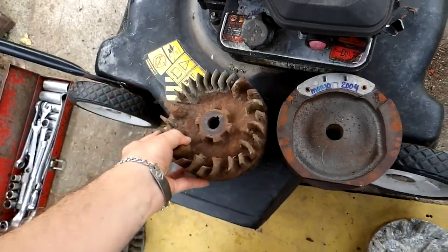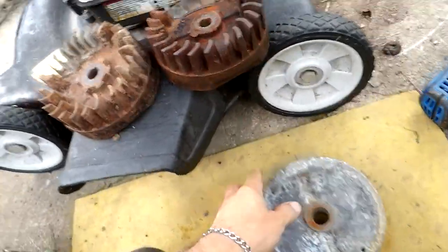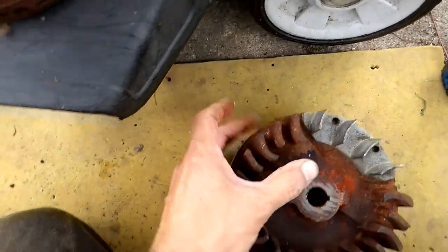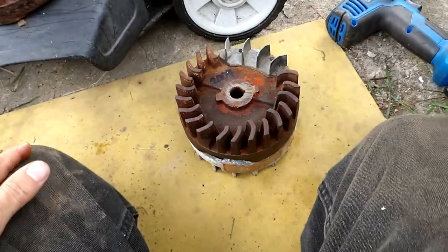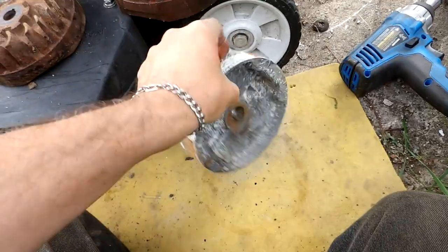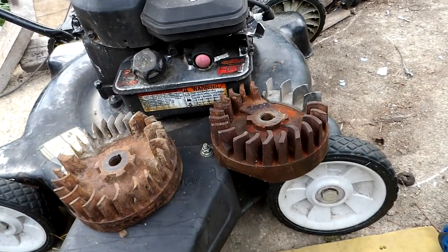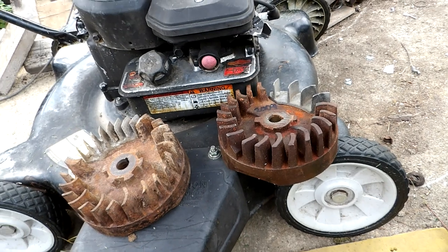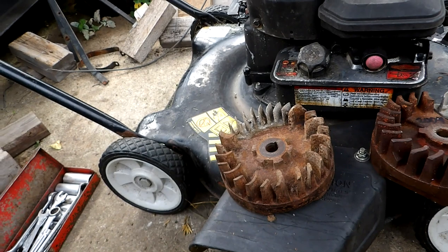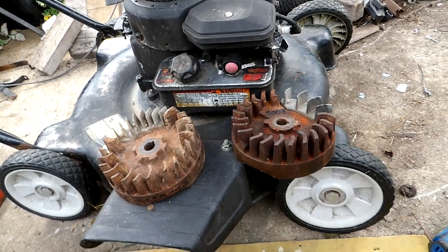So that's your two heavy flywheel options. The main thing is you'll be able to notice immediately if it's going to fit — the outer diameter's got to be the same. It is — it's identical. I've run these flywheels on my Franken-Briggs builds, like the 12-cylinder I made. I collect the heavy flywheels just for such purposes because the motor does run smoother with the heavier flywheels.